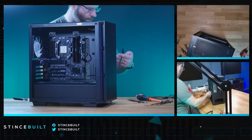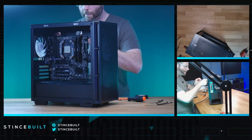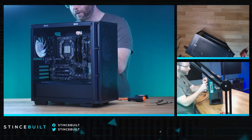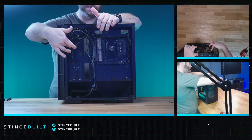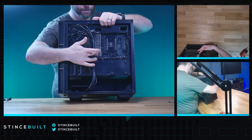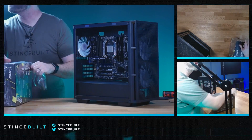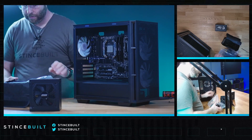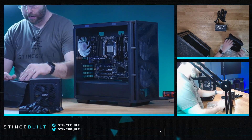We have to work on our USB 3.0 header down at the bottom, and then we're going to start working on our fans. Let's move on to the power supply. We've got the 750GL from MSI — ATX 3.0, plenty of juice for today's system. 650 would probably have been perfect, but this is a great power supply for today's system. Three cables today: CPU, 24-pin main, and the ATX 3.0 GPU cable. All the other cables are going to go into the power supply bag and motherboard box.